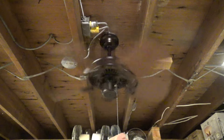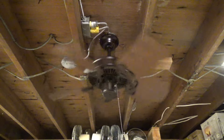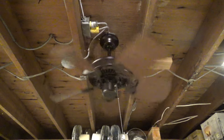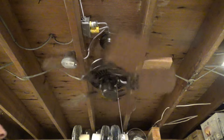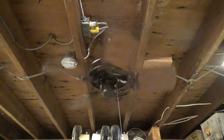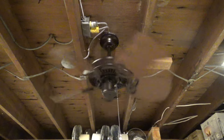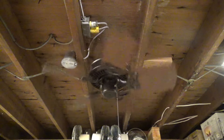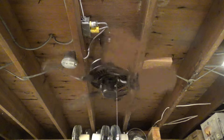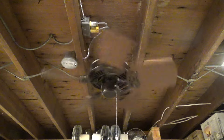Let's go down to medium. There's a nice metal pull fob with 'Craft Made' on it. At this point there's a very slight motor hum but the air noise is completely inaudible. It's still sending down a decent amount of air. Power is now 0.25 amps, 21 watts with a power factor of 0.7. I can still feel a decent amount of air moving around. This would do pretty well in a smaller room — maybe an 8 by 8 foot room.